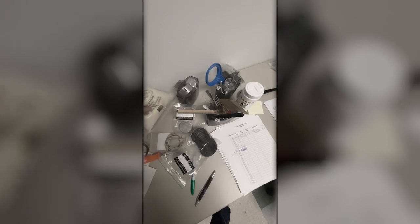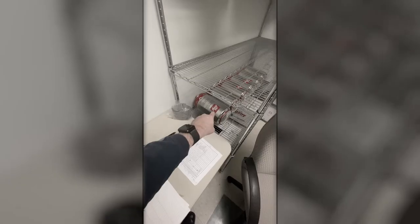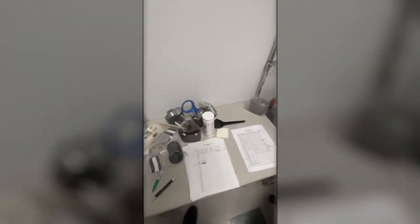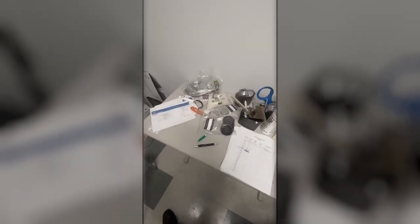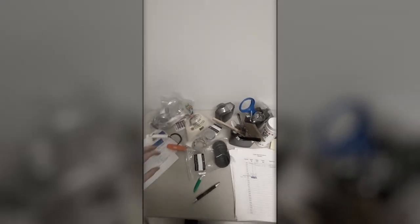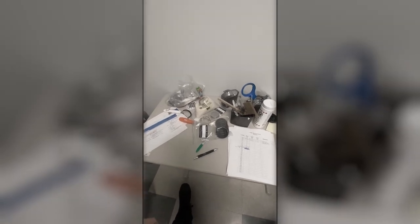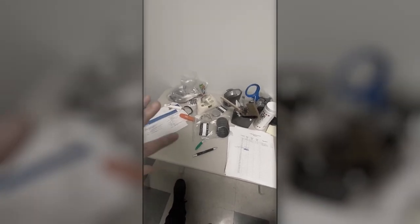There's also rice here. The reason why we have rice is should someone be so fortunate as to take beans that are not oily beans, but some oily bean, you'll find that the grinders will clog themselves up. And part of the unclogging process is to take a bunch of rice, 100 milliliters, 200 milliliters, somewhere around there, maybe 150, put the rice into the grinder and grind the rice. The rice will absorb some of the oil and help you unjam the thing as necessary.